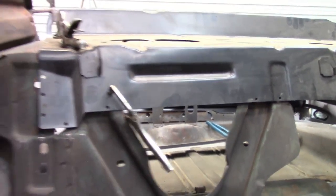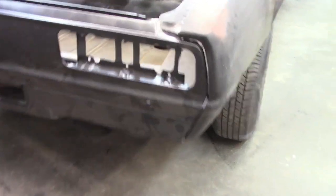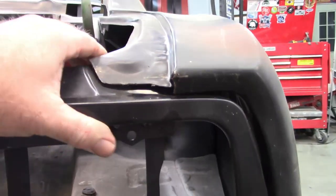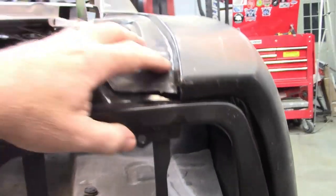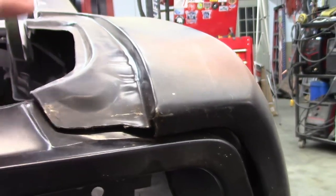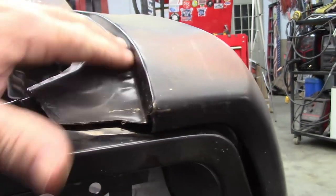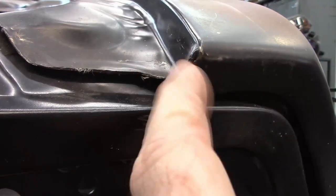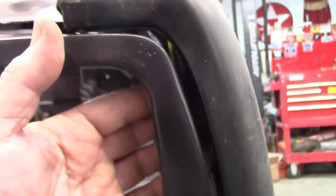In the back, I was test fitting the tail panel and a few things stand out. With aftermarket pieces, you're going to have some massaging to do. I don't like these ripples in here — I don't think the original car would have had those. It may take some filler to smooth that up. But what I see, like this corner, it's just open — there's nothing there. When I come around to the side here, what I'm trying to show you is the angle of the flange on the quarter panel.